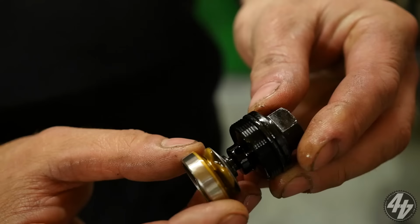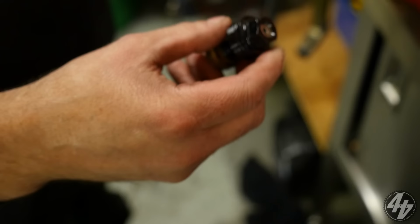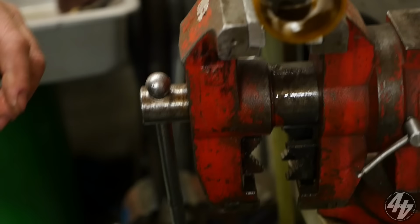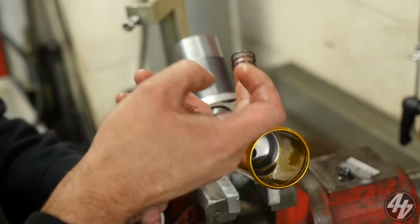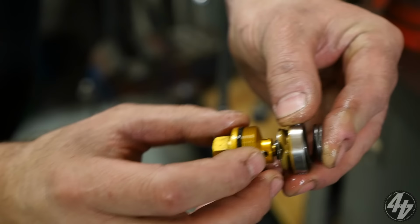Okay, that's your rebound valve, because it says rebound on it. And that'll go to the right as you look at it. Rebound right, and then it's always on the right. Technically it's upside down, therefore it's on the left at the moment. These are your springs. These springs keep pressure. When this is done up and tight, that keeps pressure on that piston.